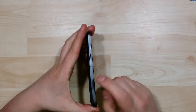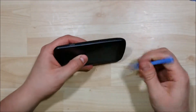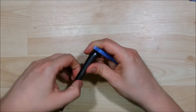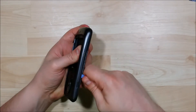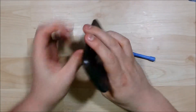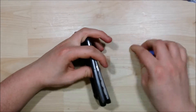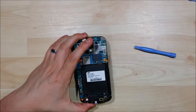The goal is to pry up the glass here. The casing where the power buttons are connected will come off. You're going to put the pry tool in between the housing and the LCD glass. Where my thumb's at, you can push on that area and get a little bit of pressure as that black area will stay — we're actually removing the housing around the outside of that. You can see me starting to separate it. Once you get one side done, go ahead and move to the other side and do the same thing. Push through the battery area and that will give you that separation that you're looking for.